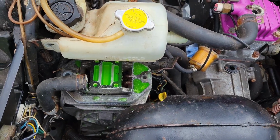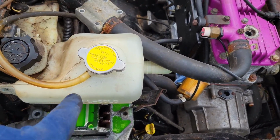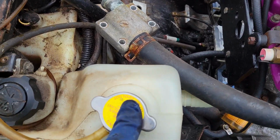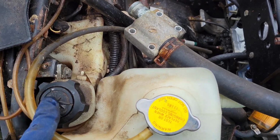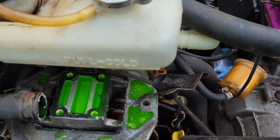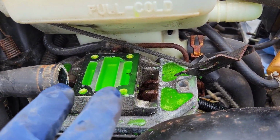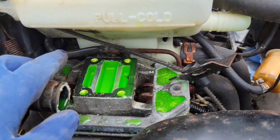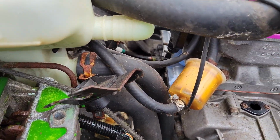Okay, so moving forward, it makes no sense. It would seem that to get the brake off, you had to take off the coolant reservoir, but to get the coolant reservoir out, you'd have to take out the oil reservoir. To get the oil reservoir out, you'd have to take out the whole steering column. There's got to be a better way. So I just went ahead and disconnected the 4 Allen bolts that held in the top of our coolant brake. Pulled the coolant tube out of the way, obviously this one as well, and then took 2 15mm bolts out that are holding the caliper in.